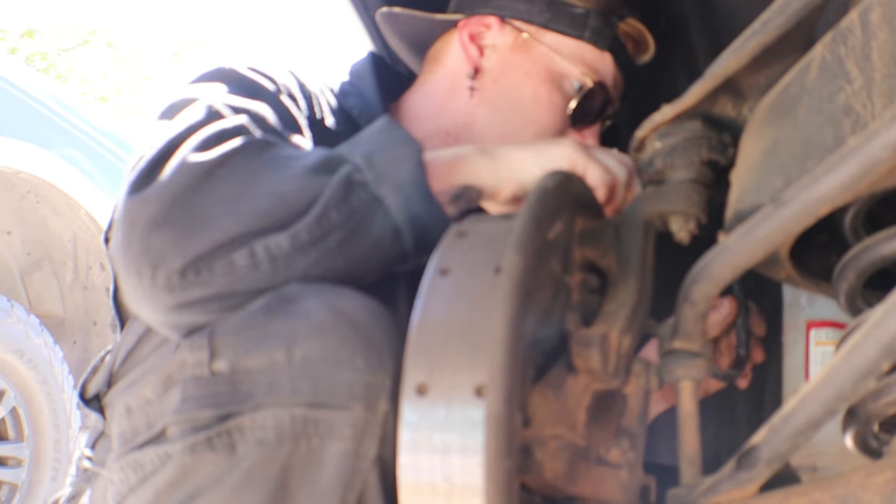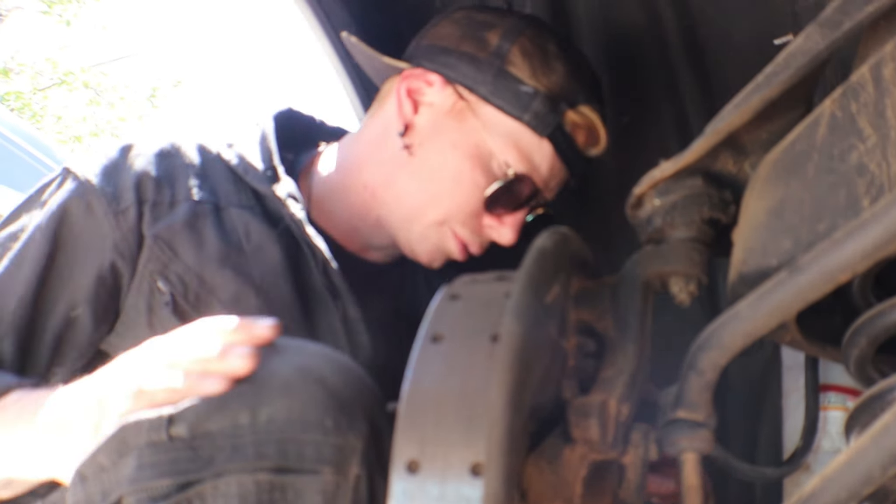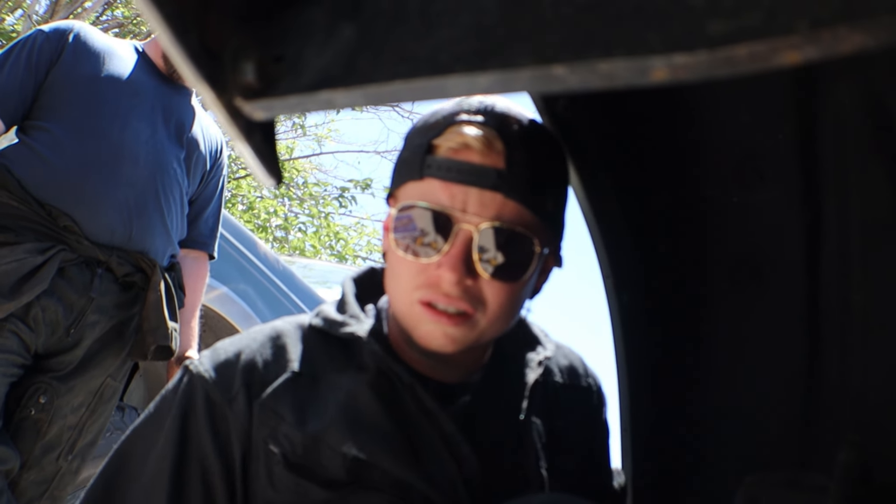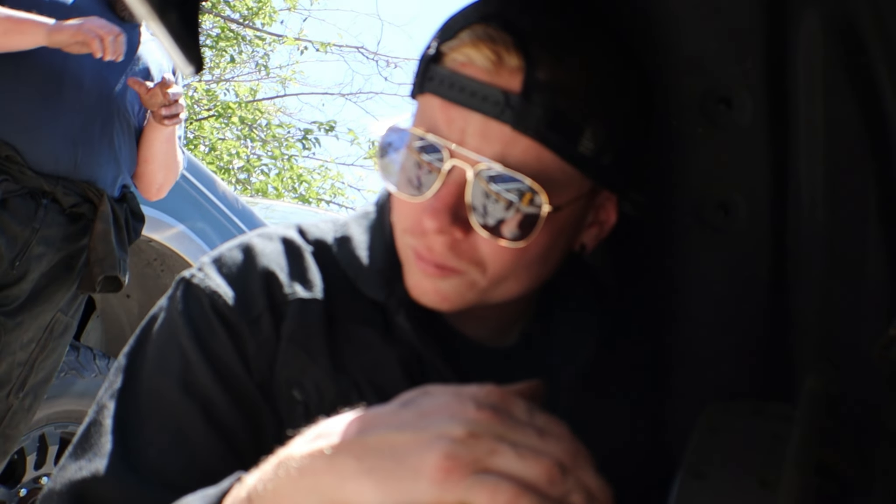Good to go. Is this thing on? Testing one, two. I don't think the brakes work. So what are you doing right now, Alex? I'm going to start on this side. I just disconnected the brake line. We took off our top clip and our bottom clip. You have your hard line that goes into the soft line down here, which then goes to the back of the drum. Now that this is off, I'm going to start taking off the bolts down here off the steering and this lower tension bar here. And then we'll take off the upper sway mount as well. Hopefully we're a little bit easier now that we've done it already. Practice makes perfect. We'll put the drum back on to protect the brakes.